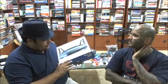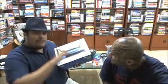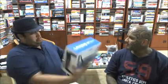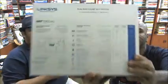It says 'AC' on the WRT1900AC — AC is a wireless standard. AC allows for much faster speeds over a wireless connection. You can go up to 1300 Mbps — megabits per second. 1300 Mbps is about four times as fast as a regular 802.11n connection at around 300 Mbps. So the AC connectivity is really fast.